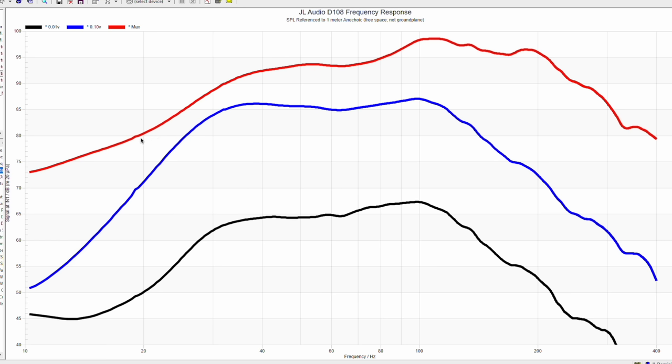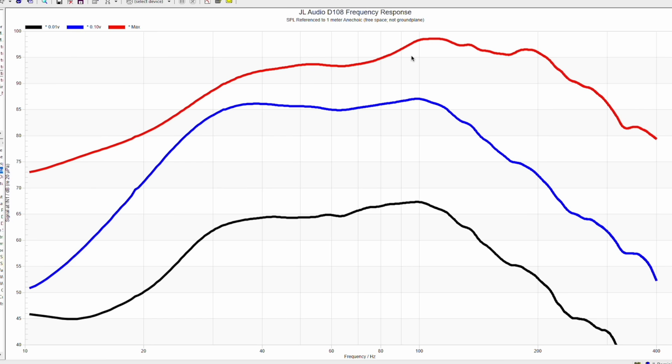The JL is not sacrificing a whole lot of low end in order to give you higher output, which I find nice — they're not just padding the frequency response by cutting everything below 30 Hz. That said, it might make it a little bit tougher to align your mains if your crossover region is around 80 Hz. If you run into issues where the upper mid-bass sounds a little hot when crossing over at 100 or 120 Hz, that could be why. Make sure you position the crossover in a way that makes sense for your room and listening level. You may never reach the red 95 dB point, and in which case you'll be fine — but keep in mind there is some limiting in the frequency response at the highest output volume.